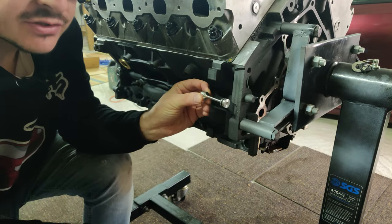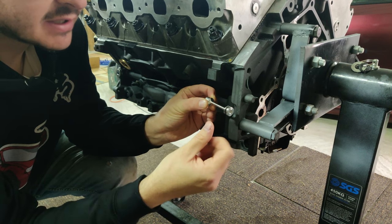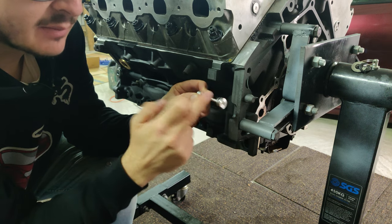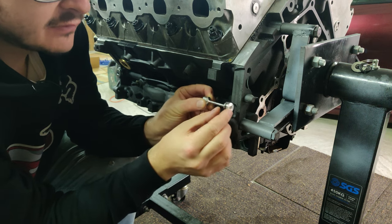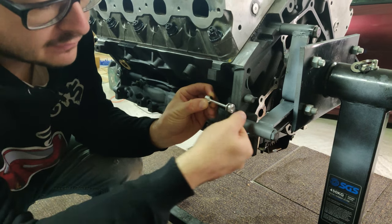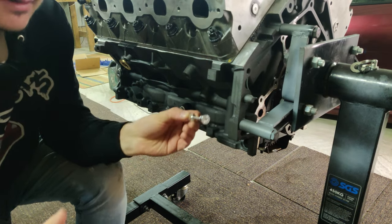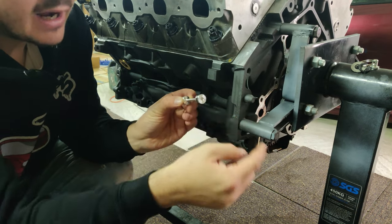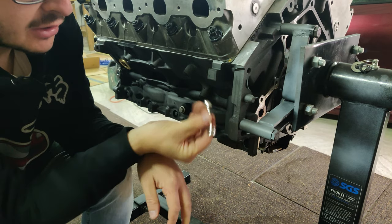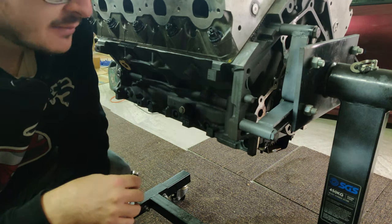To do that we need to take the engine off the stand. A trick for you if you're doing this at home: getting the old one out can be a little bit tricky, but the easiest thing I've found is to put a screw slightly into the end of the plastic one with the screw end pointing out the back of the block, then just use a pry bar to pry it out. It comes out really easily. The old one can actually be removed while it's on the stand because the tolerances are smaller, but this new aluminium one cannot go in with the engine on the stand, so off it comes.